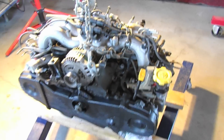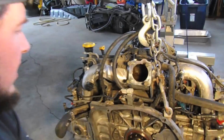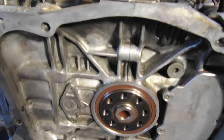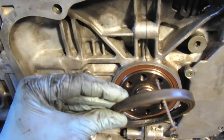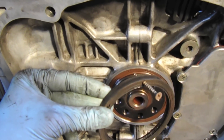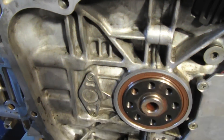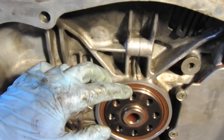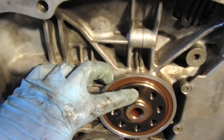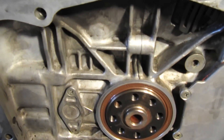There she is, getting ready to install. Just to detail what I've done on the backside of the engine — I did the rear main seal. One way I like doing it is just slightly tapping in a drywall screw and then using a hammer to pull and pry that out. One caution: you don't want to mar the surface that rotates, so err on the side of tapping it in closer to the block side.